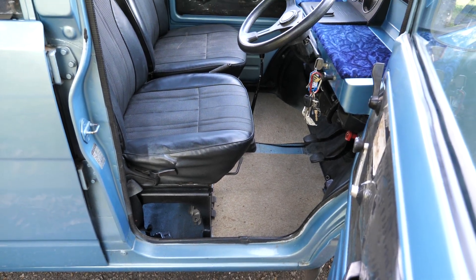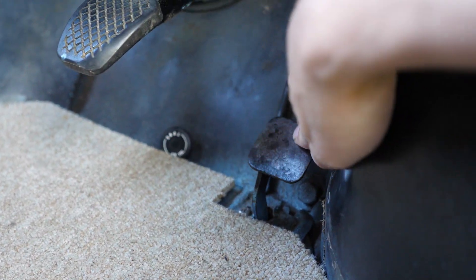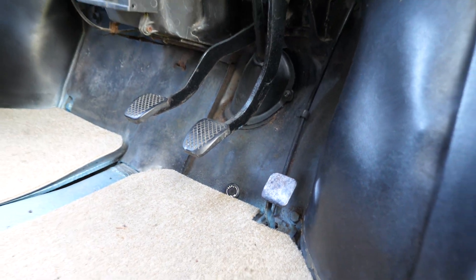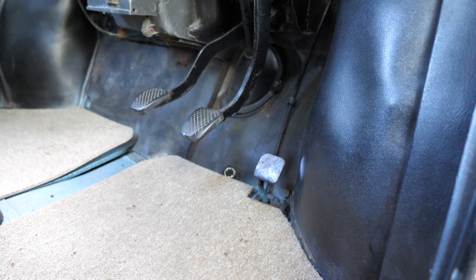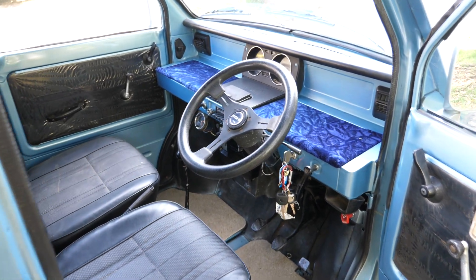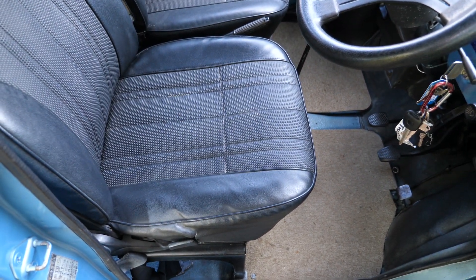It has no carpet in it, and some carpet squares have been cut to fit. The gas pedal is like a weird little lever on the floor. It is a carbureted car, so when you get into it you have to remember how much fuel is in your carburetor float. If you haven't driven it for a while, you have to pump the gas pedal a few times. If you're getting into it when it's still warm, you don't have to do that, or you can flood the engine. If you haven't driven a carbureted car before, you need to look up how to manage one.